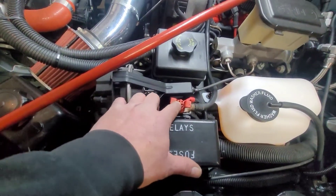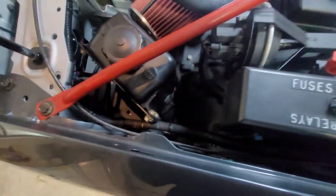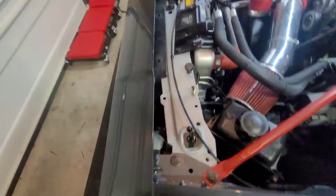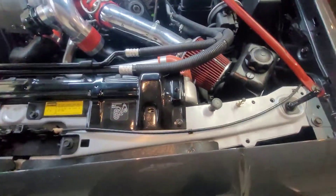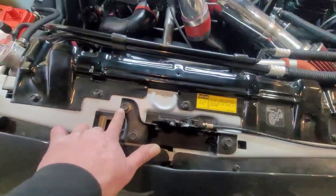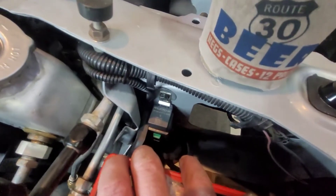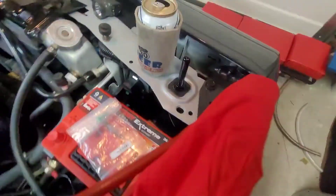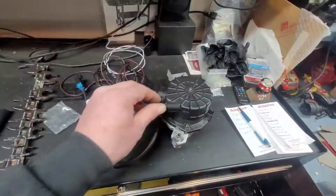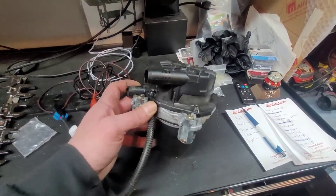After a bit of work, the wire harness is installed. The main harness comes from the power lug and kind of loops around, hidden under there along the split loom where the headlight harness goes. This is a fuel-injected car with a lot of custom wiring. It runs on the bottom side of the radiator support along with the factory harness, loops around — you can see the relay, the grounds down there — and the harness runs the pigtail for the motor under the fender.